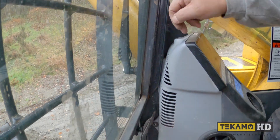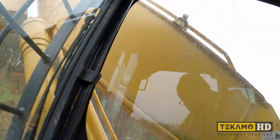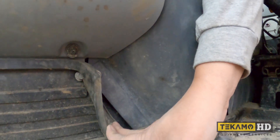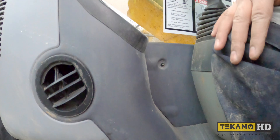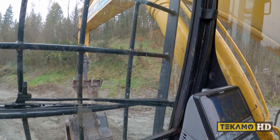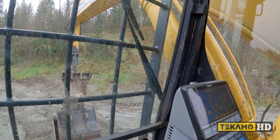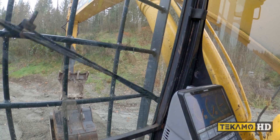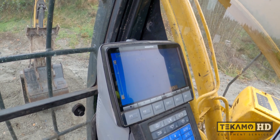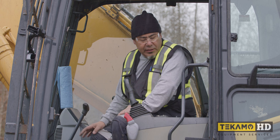This panel right here is held on by two screws, and there's one at the bottom. I also had to loosen off this other one and a couple more in behind. Everything's back in place — testing it again and the wiper is working: intermittent and also first speed. We had an error code on the monitor, but I cleared all the codes and we should be good. We didn't see anything wrong with the connections, so the wiper issue appears to be resolved.